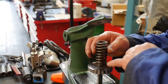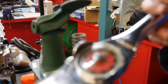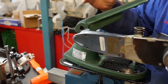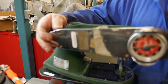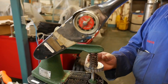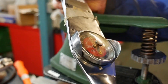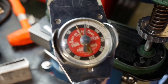Now we can put our spring on there. There are some circular grooves in here so you can center the spring. Then you take a dial-type torque wrench, zero the needle, and insert it into this tool. Once the tool is triggered you have to reset it — to reset it, you just lift it up. Put our torque wrench in there, and then we pull down until you hear an audible click. I'm pulling, the needle is moving up and up, and there's the click — I stop pulling. Now if I look at my wrench, it says that I have 35 foot-pounds of torque to move that.